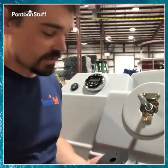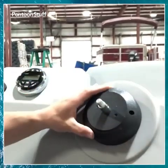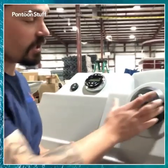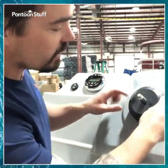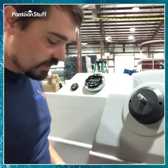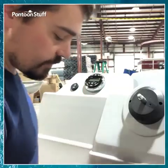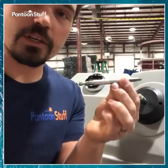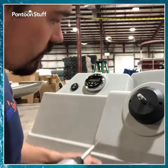The next piece is installing your bezel, which is going to cover everything we've created underneath and give you that nice clean look on your dash with the steering wheel on top. I'll square everything up and run my two stainless screws that come with it right into the dash. You'll often need an extension for your drill bit because these are buried — you don't see the screws.